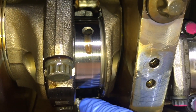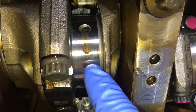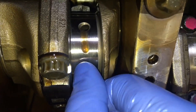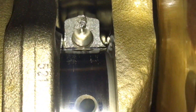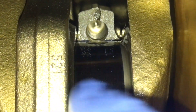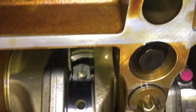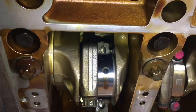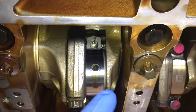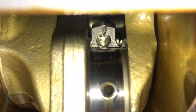We've also got some small lines on the crankshaft journal — this one's a little more hazy. Both bearings hadn't spun; the cap and con rod locating tabs were still in there. But we've got a polished line where it would have been originally and the rest is a bit hazy — though visually it seems okay. There are also some imprints or marring just up there that you can't really do anything about. We can advise someone might want the crankshaft checked or polished, but nobody realistically goes for that because of the sheer work involved — it's an engine-out, gearbox-out job and a partial strip down to get the crankshaft out.